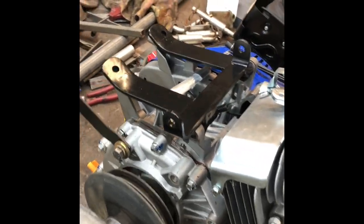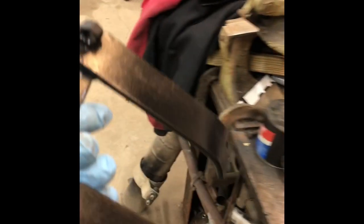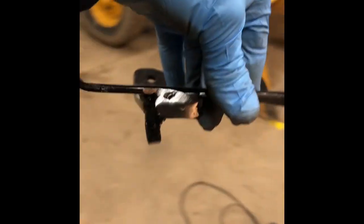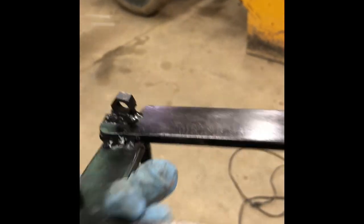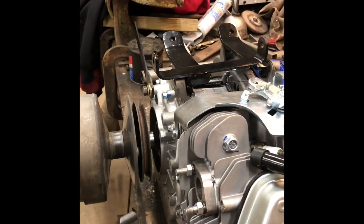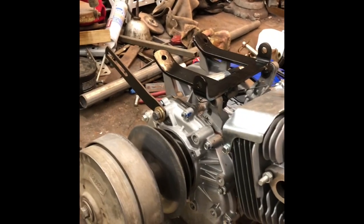Here's the starter generator bracket — I got it painted and cleaned up. These arms come up at an angle, so I just put a bolt through there and a nut. I set these pieces on there and was able to tack the nuts on. They're at an angle but I ended up welding them all the way around and ran a tap back through them. One side's lower on these arms than the other, so it didn't really sit level. When I put the other bracket for the generator on there, I just held it up where it needed to go, eyeballed it, put a straight edge from pulley to pulley. That's the finished product.